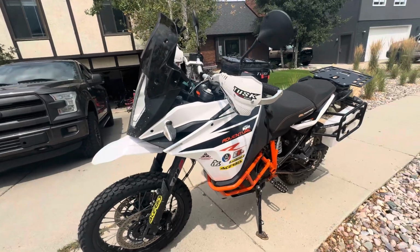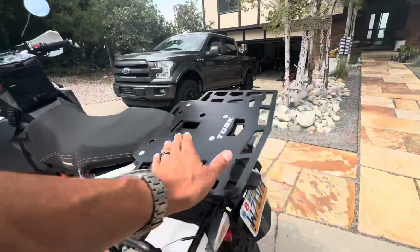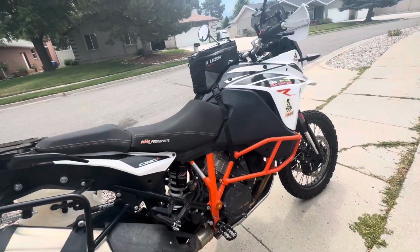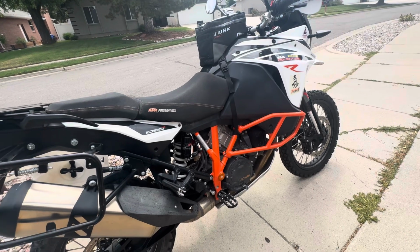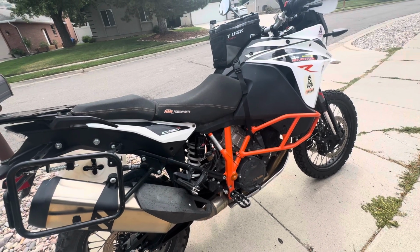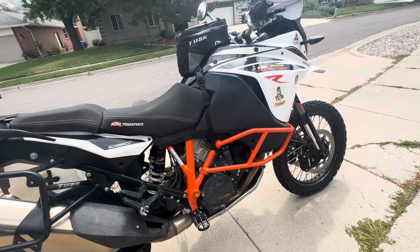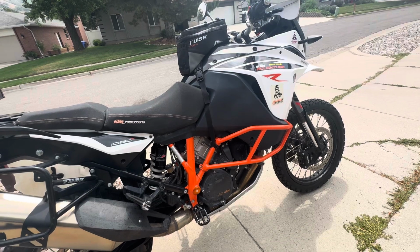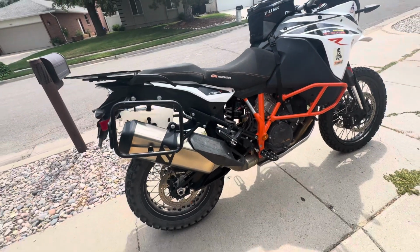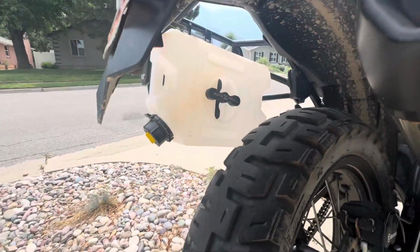And then the third is that the crank position sensor can go bad. I think those are fairly cheap. The fuel pumps are like $500, the genuine KTM ones. The crank position sensors, I honestly don't know, but my guess is $50. If I was doing real long trips, we just did a 500-mile trip, never replaced the fuel pump, never had any issues, never had a breakdown. It's just been phenomenal. Same for me and the previous owner, my friend Chad, who sold me the bike.